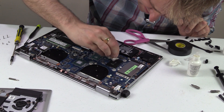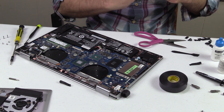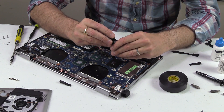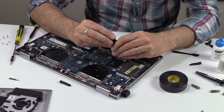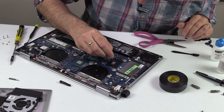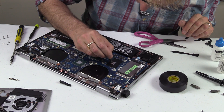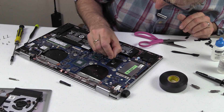Once all taped up with electrical tape around the CPU area, it's time to clean the CPU heat spreader with Arctic Silver surface purifier to make it nice and clean. Then apply the Thermal Grizzly Conductonaut — it comes in a black syringe. Gently press it down and put a rice-sized bead on the heat spreader. Spreading liquid metal is tricky and takes practice. I found it best to grab the top surface tension of the liquid metal and drag it around the heat spreader, taking your time to get a nice thin layer covering the whole surface.